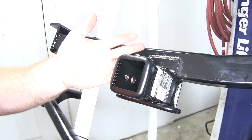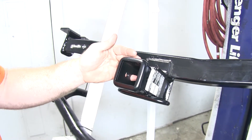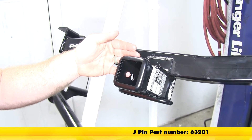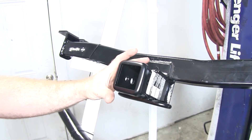On this Draw Tight, it's going to have two pinholes. It's got the standard 5/8 inch hitch pinhole that's going to be used to secure all the Class 3 accessories, and it also has the smaller half inch hole, which is going to be good for use with a J-pin stabilization system, which helps to eliminate some of that shake and play in the shank to help provide a nice, quiet, secure ride for your accessories.